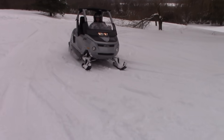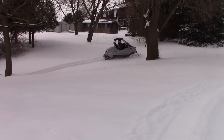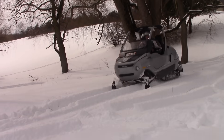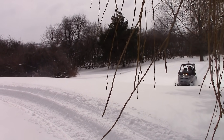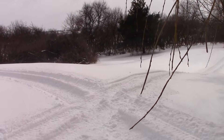Now driving this big Elite, the clutch had some work to do. So Skidoo went with the TRA4, but a variation of the clutch designed for the V1000. It's smooth, accelerates, hooks up well, downshifts, backshifts — does it all, pushing this big sled with the big tracks with that big 1500cc engine.